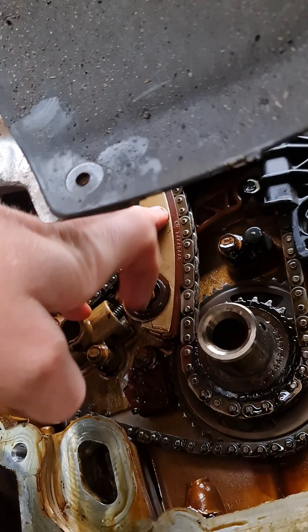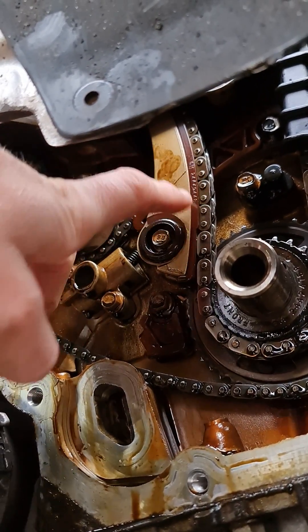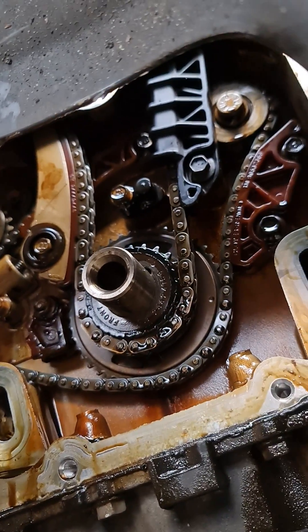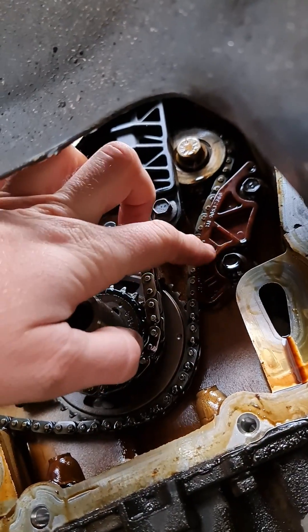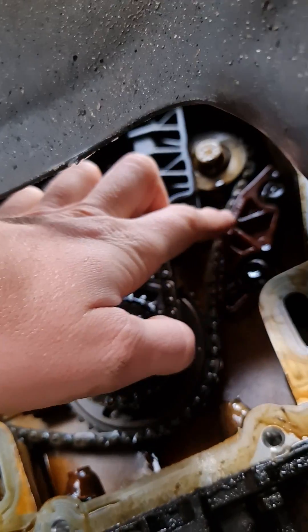The rest of the guides are good. The main one for the timing chain — this one which is made of metal, luckily, with a plastic shim on it — that's still good, the top one is still good. And this one here — how this one didn't get destroyed as well, considering that when this popped it basically flew over here, I don't know.